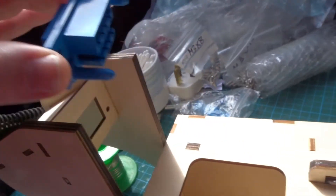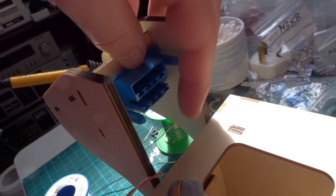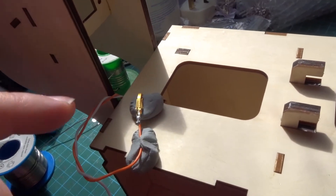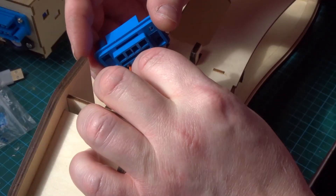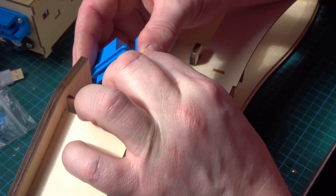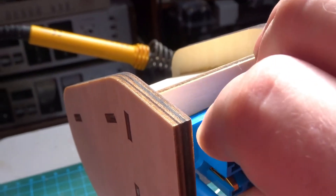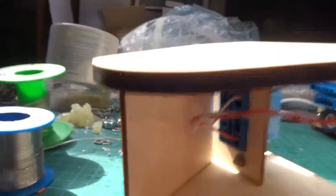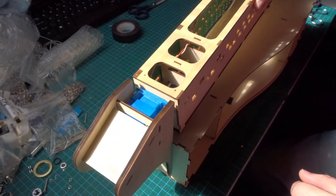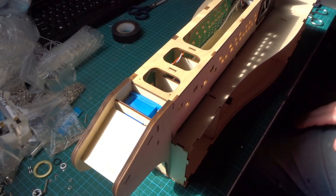Now I'm going to snap them into the backs of this plug, then with the two bolt holes bolted in here like that, triple checking that the wires mate up with the correct wires in the plug on the key box — the orange to orange, white to white. You have the curved rounded side upwards, feed it and it should just go click. Feed the wires through from the back so that this thing goes in like that, screwed in now. We need to check whether the two plugs engage — bring it in at an angle. So far so good, give it a push. Yeah, they seem to engage pretty well.